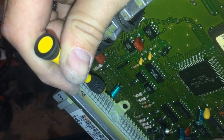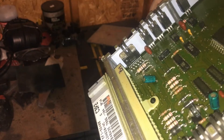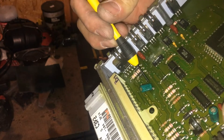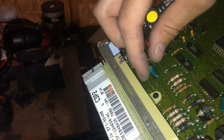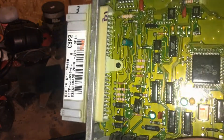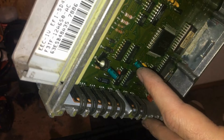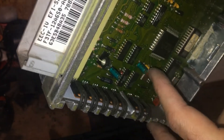That circuit is no longer working, so you can tell if your ECU is in need of replacement. You can replace these yourself if you're good with soldering. You can replace these capacitors — they tell you on the side of them what you have to have: the capacitance and what you need. But you have to be very careful replacing them. There are a couple of people that do this as a side job for testing and repair. Those other capacitors look good too — if there was any green fuzzy stuff at the base of the connection, that's how you'd be able to tell if they're bad.